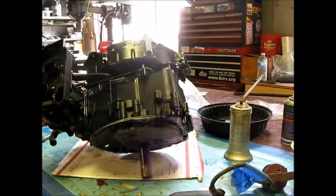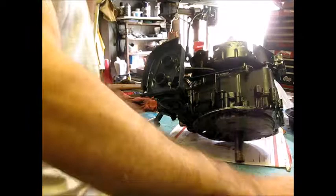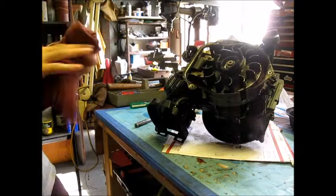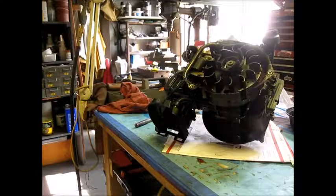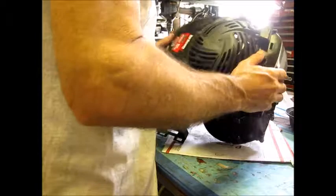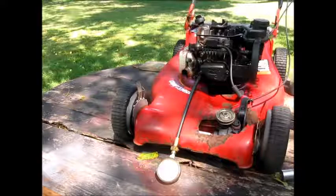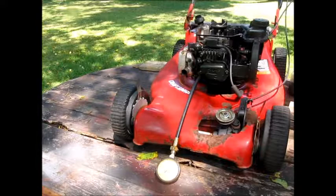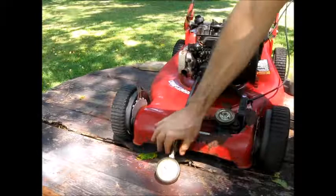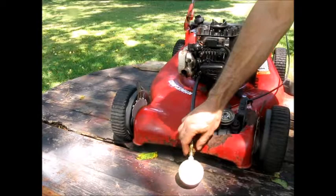Okay guys, we're almost done. The next step is we've got to cover this — that's your pull starter — and this baby gets just this plastic cover. I got the cabling on, had to lubricate it — it's an old cable. Let's give it a shot. Whoa, look at that! Okay, that's basically dry with really nothing in there and you got over 70 pounds — 75 pounds. You've got a good 75 pounds of compression. This baby will run. Let me put a plug in it and get some fuel in it.